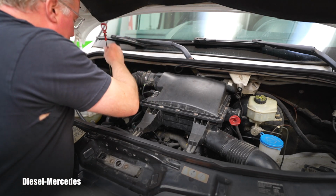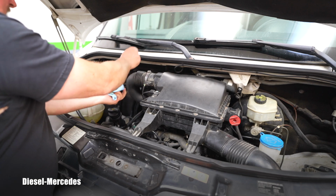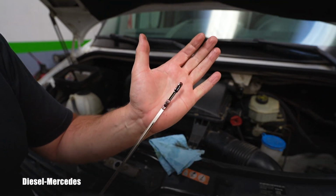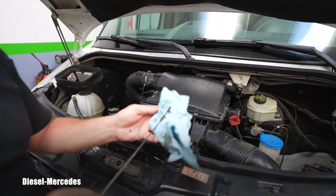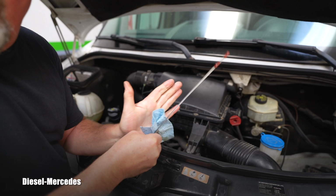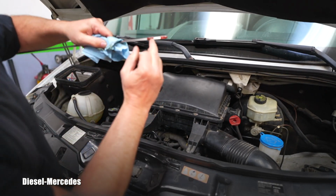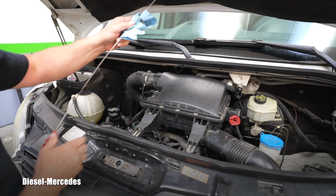tube. So since it's right on the edge, and I'm assuming when it gets hot the computer will say it's too much, I will go ahead and actually remove a little bit of that oil from the engine, because I really want to see it only between the marks, because it's triggering that light.